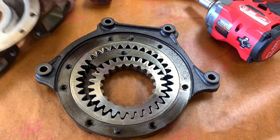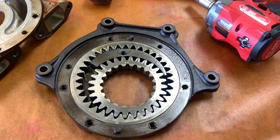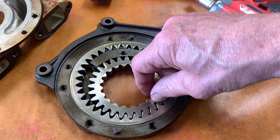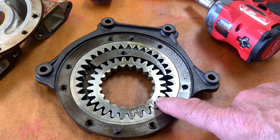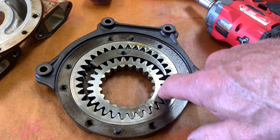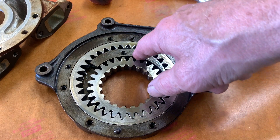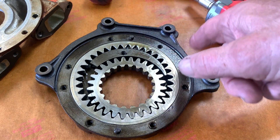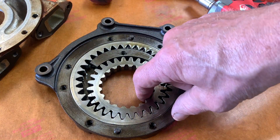It's a kind of pump called an epicycloidal pump — the same sort of pump that you've got in an automatic transmission, and it's a high volume pump. This thing provides way more volume of oil than the bearings actually need, so that you can have the bypass delivering oil to the cooler, which then routes the excess oil back to the inlet of the pump.